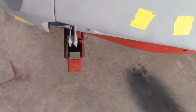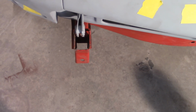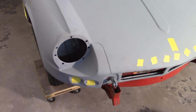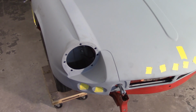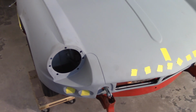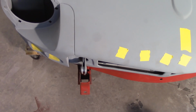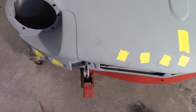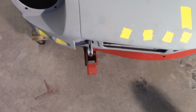So, hopefully, that tells me that I need to loosen that guy up, the pivot tube itself, and maybe get lucky here and try to slide that over a little bit. But the kicker is, unfortunately, I got to get in and loosen everything. So hopefully I can do that with the car as it sits right here. I should be able to get to everything. So I'm going to loosen that pivot tube up, see if I can center it up eyeball wise in the hinge, and maybe in doing that, that won't put any pressure transmitted down the wing, and hopefully that can help out a little bit here. We'll see.